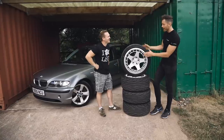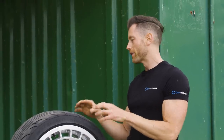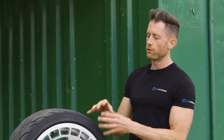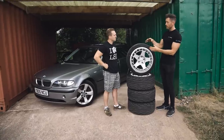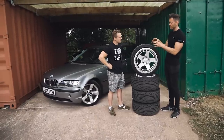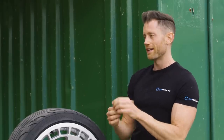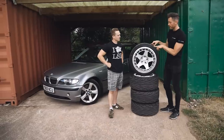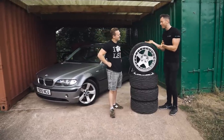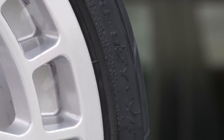18s look a bit better. What you get with a bigger rim size is a little bit less sidewall. Especially with this car where power isn't huge, we don't want to be increasing the circumference of the wheel and tire combination. Going up to a 19 or 20, you'd end up with rubber band tires to keep it the same circumference. That increases the overall final drive, so your acceleration gets slower and your top speed gets a little bit higher — but for this course, you don't want that. We've actually dropped it by about a percent on the rear, so 1% more acceleration. It's like free power. The 18-inch gives you a nice blend of sidewall stiffness and weight, because weight is super important as well.